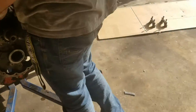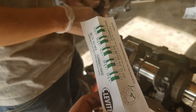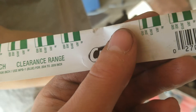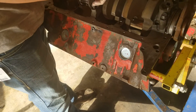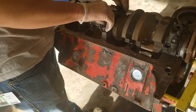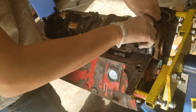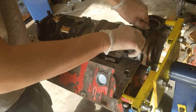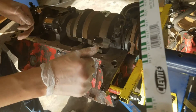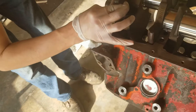We got them all torqued down — let me move so the light is good. We cracked them loose and we're pulling them off. When you pull these off, take them off somewhat carefully and leave the plastigage right where it sits on the bearing surface, whether it's stuck to the crankshaft or to the bearing on the inside of the cap. Just leave it right there, because if you touch it, it could warp it slightly. The stuff is super bendy — if you try to pick it up, it could bend right in half and then you won't be able to measure anything.